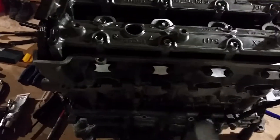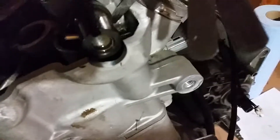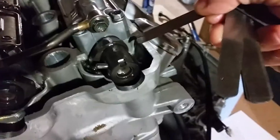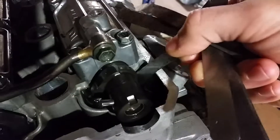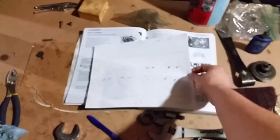How you're going to do that is with thickness gauges or feeler gauges. You're basically going to fit them in between the cam and the tappet like that — it's pretty hard to show you like this, but once you're in there you'll see pretty easily how it works. You'd be coming in like this, in between the cam and the tappet, to feel the thickness. When you're doing it, you want to be able to slide the gauge in easily — not so tight that you're forcing it, and not so loose that it just flops around. You want it nice and smooth in and out — that's how you know you've got the right reading.